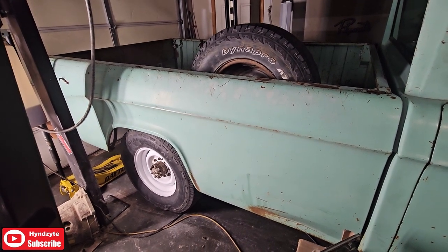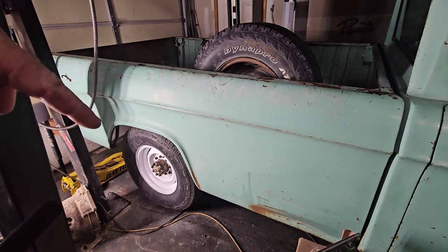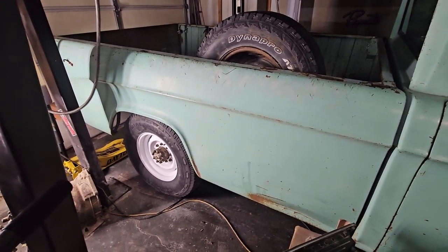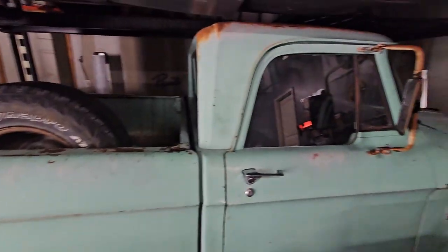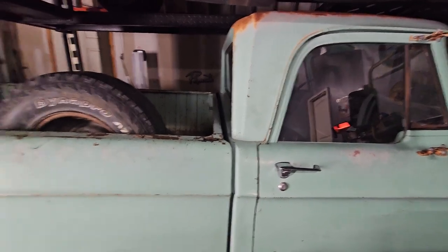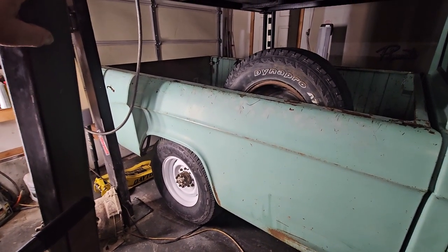When I look at the tab on the back of the differential, it says 355, but all the math says that's not right with a 31-inch height tire. On the website they have the calculator that you can put in tire size and gear ratio of the transmission. Everything I have seen says for a 435 four-speed transmission, that fourth gear is 1-to-1 ratio. So I put that in there with the 355 gears doing 65 miles an hour, and it's nowhere near 3,500 RPMs.